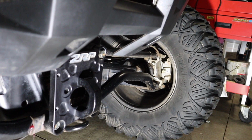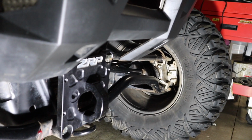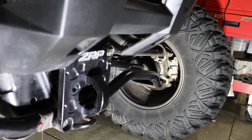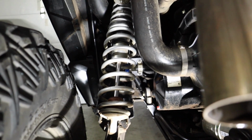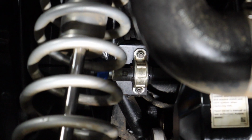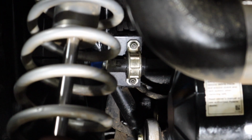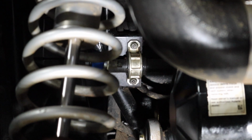So other than that, from the creaks, squeaks, and moans that I've had with my machine, the rear sway bar mounts, make sure that you grease those. The Zerk is up underneath and they're kind of a pain to get to. But that's another point, and you can just see the sway bar mount there. So I would also make sure to grease those before you go out on the trail, and that'll prevent even more squeaks and annoyances. That's it for tonight.